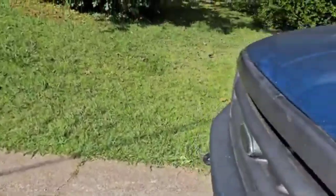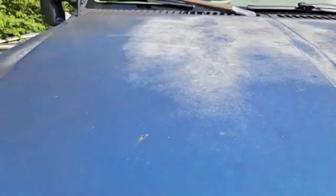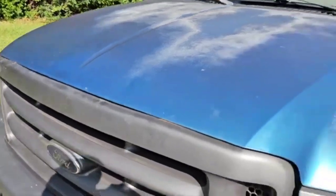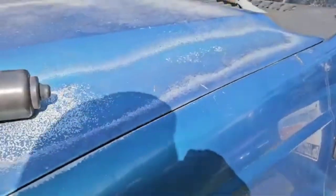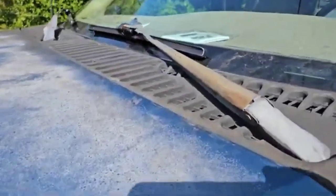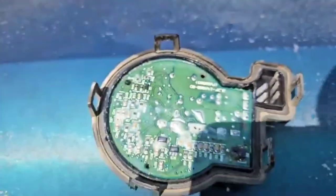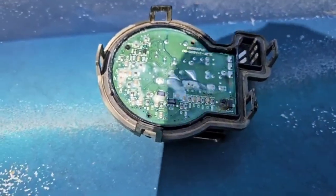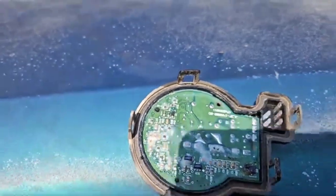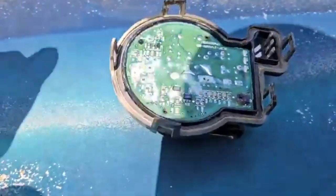Couldn't find anything online about this. There's a black and white wire that goes down to the pump — that was the power wire. So I tracked it back to the inside of the engine compartment, and that wire went up to the motor for the windshield wipers. There was only one other wire supplying power to the motor. So I proceeded to take the windshield wipers out. When I got the motor out, it has this circuit board in it. There was nothing online about it — this is just to maybe help somebody. If your windshield washer quits working and you've checked everything else, it ended up being this circuit right here.